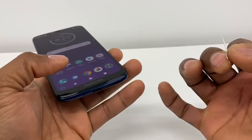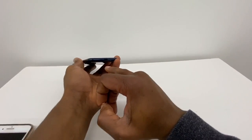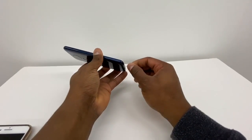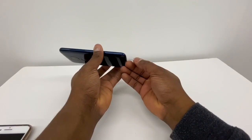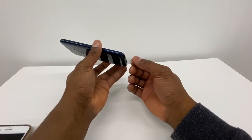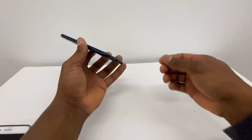You're gonna use something like this — a pin or toothpick — and put it right in the hole where the mic is, right there. Put it in and move it around. Sometimes a lot of dust gets inside, and that's the simple reason why the mic is not working. It's really simple and fast to fix that type of problem.